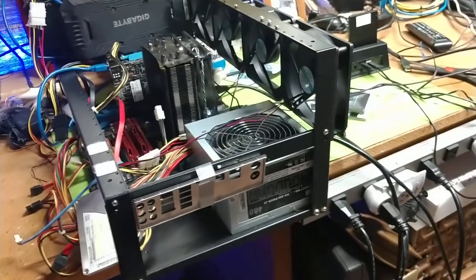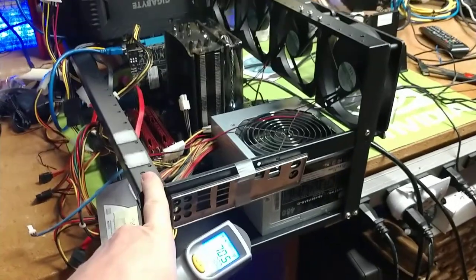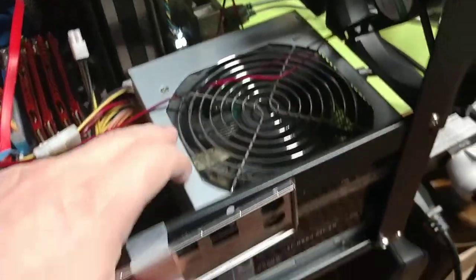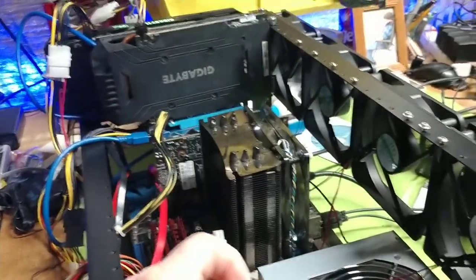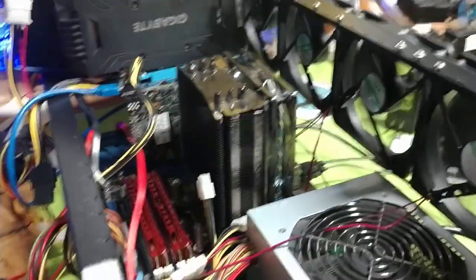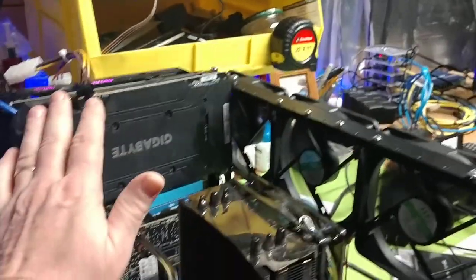In here I have an open rack, which is a very common open rack, but I've made one crucial detail: I want to make sure that I'm using conductive constructs for my framing as opposed to insulated constructs — i.e., wood — so that I have what the video card itself needs, and that is proper distributed surface area for grounding. The power supply's outer shell housing can create a pathway for grounding, and everything screwed into a PC case keeps both the RF under control and provides a pathway for grounding, because these screws are interlocked with the metal of the frame. Wood is okay as an insulator and has some functionalities, but one bad thing about it — especially when dealing with heat — is the nature of these cards and the voltage load, which can produce genuine fire.